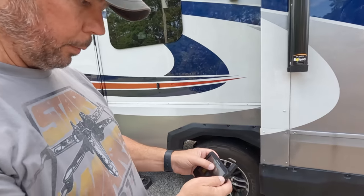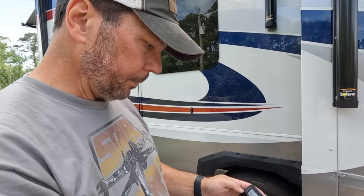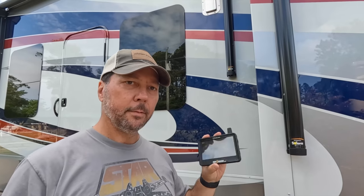Now I'm just gonna go into my pressure setting, set it to 120 PSI, save, done. Nice. All 12 tires are now programmed in with the appropriate high and low and temperature programs, all done. And it's been 4 minutes and 24 seconds since I hit record when you were explaining. So it's less than 4 minutes to do all that.